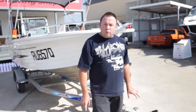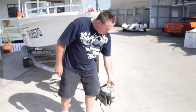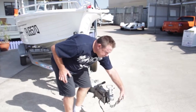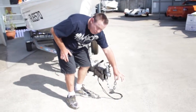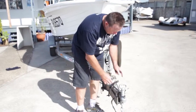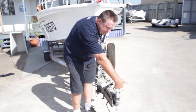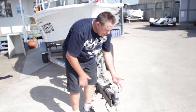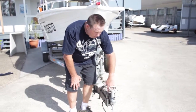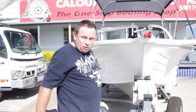Once you've done a run through and pre-checks on the boat, it's wise to always have a look at the trailer. Make sure when it's hitched on to the car that you lift the button up and make sure it's down - I always like to lift up and double check it's nice and secure. We run a safety chain - always make sure it's got a nice shackle to a fixed point on the car. The law says you must run a safety chain. We have a braking system on this particular trailer. You can use a park brake at home, or just flip the mechanism back - when the car slows down, that pushes back and activates the brake. We have a reversing lock to stop the brakes from being applied, only necessary if you're backing up a hill. Always make sure the boat's nice and tight on the winch - if it's rattling, it'll rattle the trailer loose quite easily.